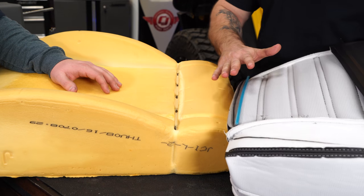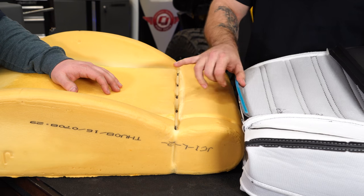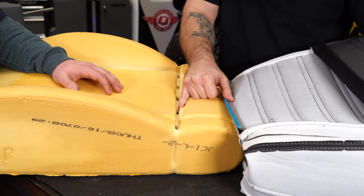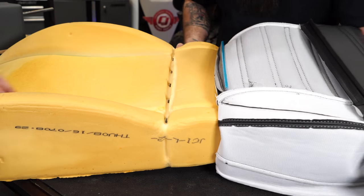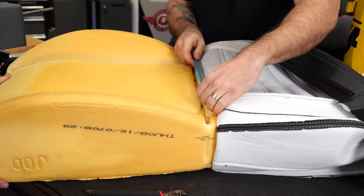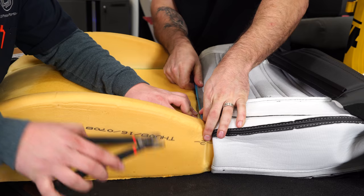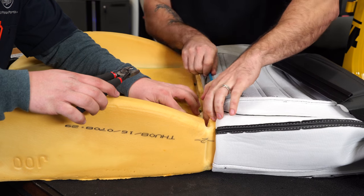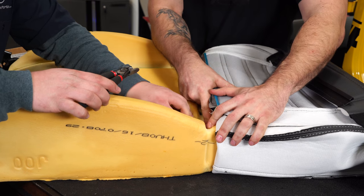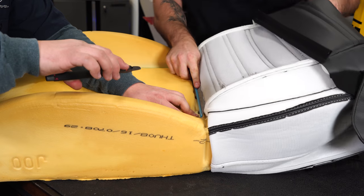When starting with a tall bucket like this, it's best to turn your upholstery inside out. This gives easy access to the listing channel that we're going to hog ring into the listing rod. Go ahead and insert the top of the bucket — it's going to want to fight you a little bit. Once the top is fitted in, the listing rod is going to line right up. We're going to hog ring the blue channel to the foam — there's a wire embedded in the foam and we're going to connect those two with a hog ring.